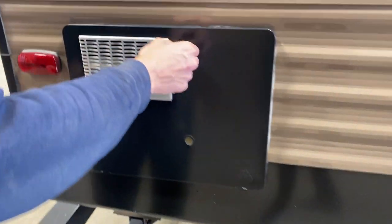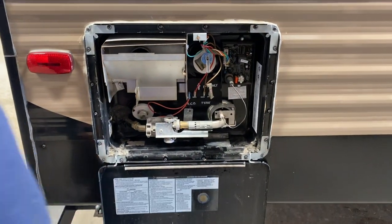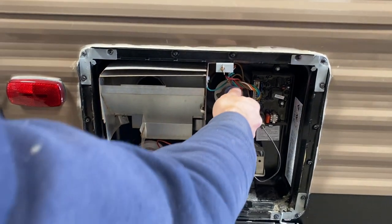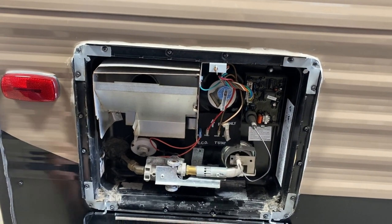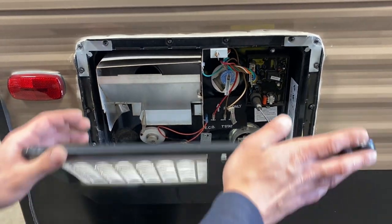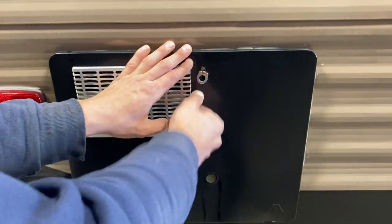In the back you've got your hot water tank. Line up the keyway and pop it open. All the controls for turning it on are just inside the unit. Before you ever fire it up though, hit that relief valve and make sure a shot of water comes out — water coming out means the tank is full and it's safe to fire up without burning anything out. Close it back down and lock it with the keyway.